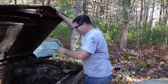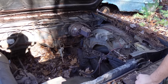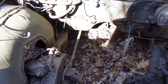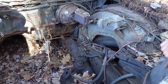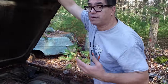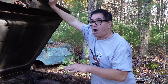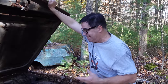Getting back to semi-unitized construction — somebody has so conveniently removed the 440 for us, so we can better see it. What looked like frame rails going onto the firewall actually extend under the front seat. The firewall all the way to the taillights is a structure that has its own rear frame — semi-unitized. Kind of like a '67 Firebird or Camaro has a bolt-on subframe, so too does the '67-up Imperial.